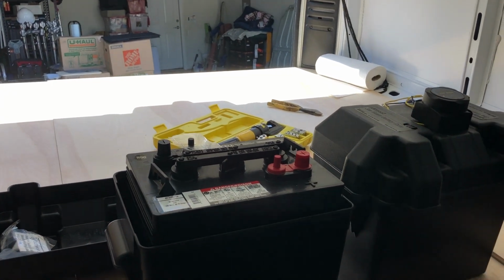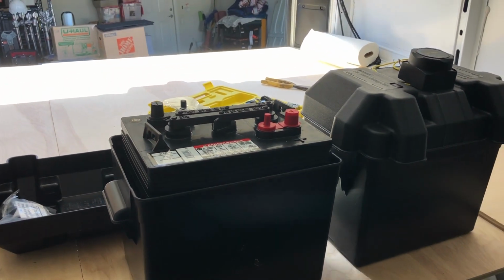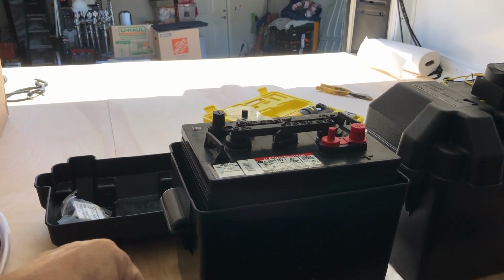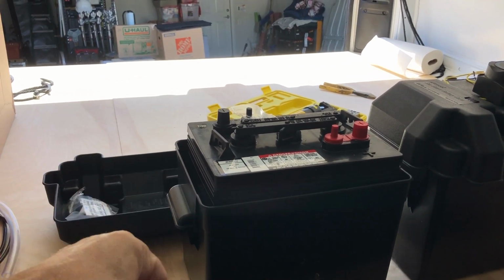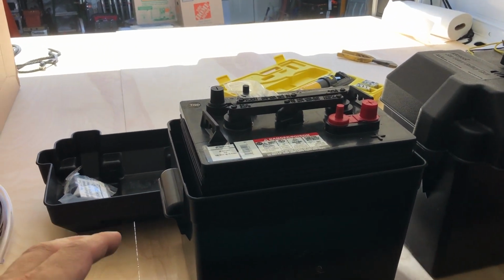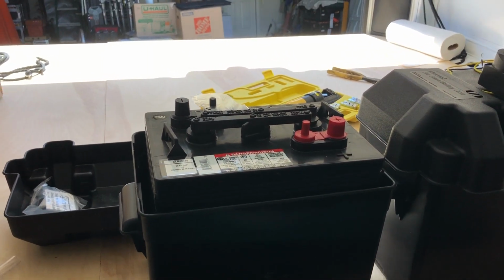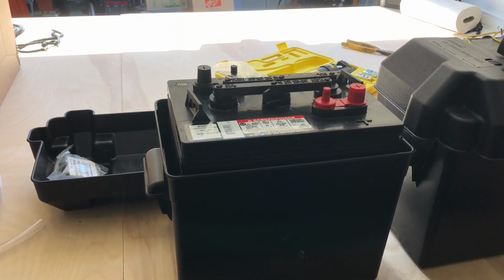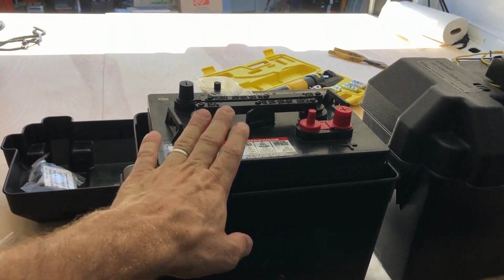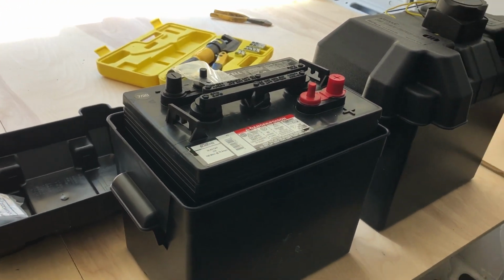Alright, so house battery bank. I wanted to install one of those lithium power banks that's like a self-contained case that's lithium batteries, a charger, a solar charger, AC charger, and a 120 volt inverter for AC, all in one, because they're like double the capacity, and it effectively makes it 4 times the capacity, because with lithium you can draw all the way to the bottom, where a conventional lead acid you can only go down to about 50%, or a deep cycle like these you can go a bit lower, but everything's back ordered.